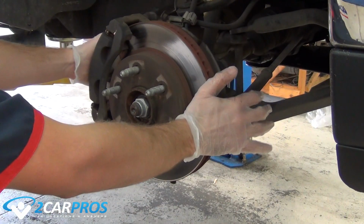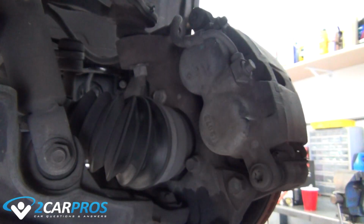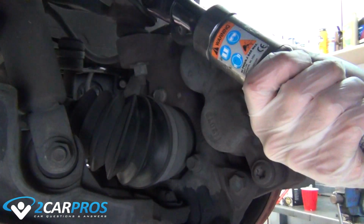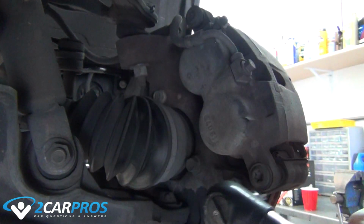After removing the front wheel, we are going to turn the brake rotor, making the repair a little easier on us. Our next step is to remove the 2 caliper slide bolts using the appropriate tool and size for your vehicle. Some vehicles will need a wrench to hold the slide bolts mounting hardware while using a socket to remove it.